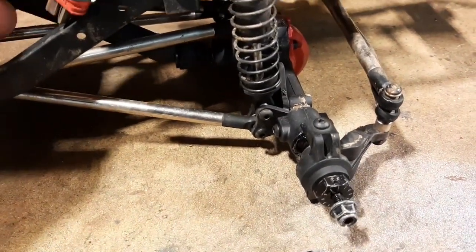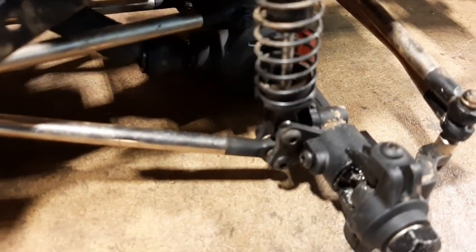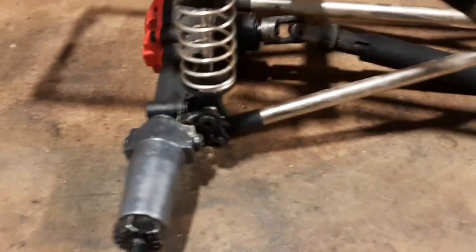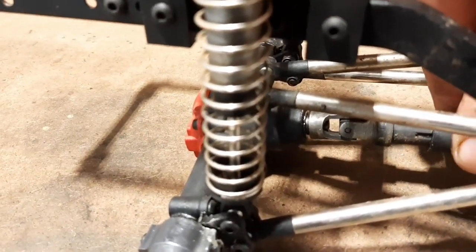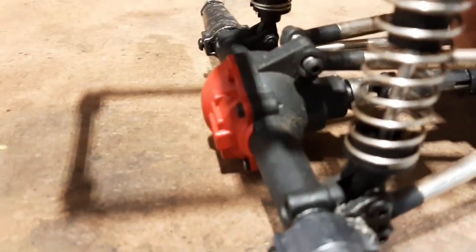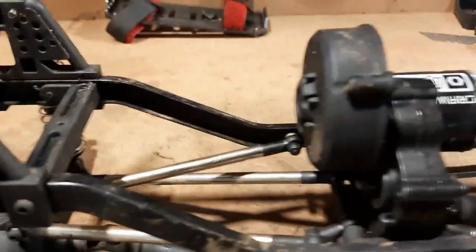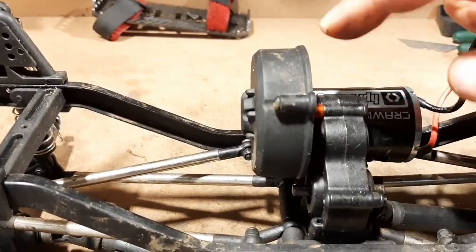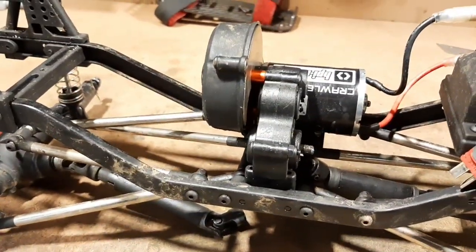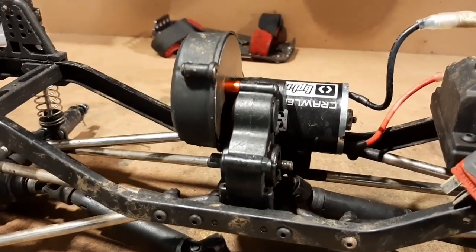Neither of them feel tight. I will give them a strip down and clean anyway, as I do often, because they get glungy. Also, you've got the bit of lash between - see where that's moving there. That then goes on to the gear that goes on to the diff, so if that's moving about you can end up shredding that gear. Either way, we know the problem currently lies, rather unsurprisingly given the abuse it's had, somewhere in there. It's all metal gear, so it's either going to be a rusty horrible mess, or we've got a bearing gone.